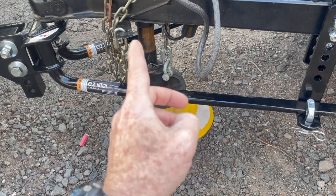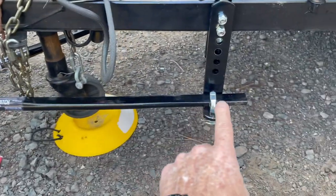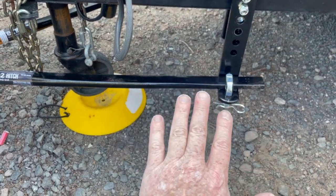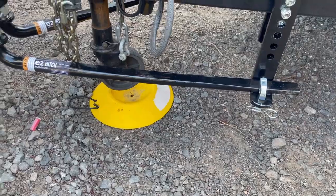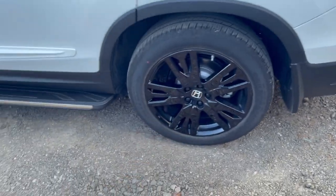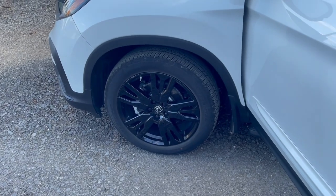You can see the angle of my hitch. You're going to want to put bearing grease there to quiet the noise, and put some grease on this surface right here as well, which will also decrease noise — because this is where you get not only your load leveling but your sway control. Taking another measurement now that everything is on the hitch: we're at 33 inches on the rear wheel and 32.5 inches on the front wheels. So it has transferred that weight forward.